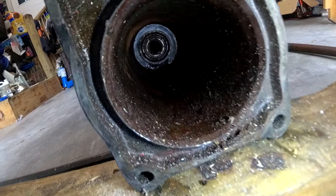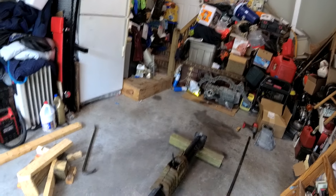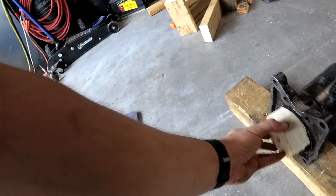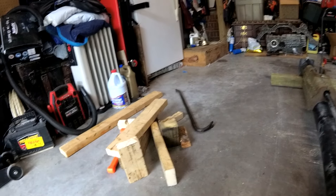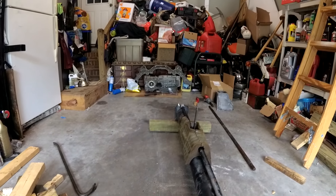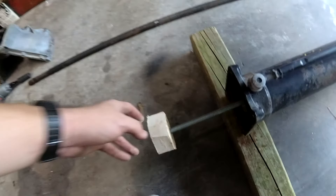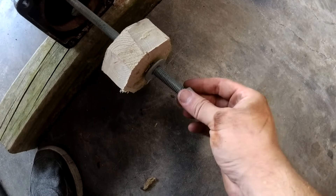There's some dirt and stuff in there — we can try and get it out before we drag the bearings out through it. First things first: I don't have any fancy woodworking tools, so the wooden block I cut out to fit in there looks like crap, I know. We've got some all-thread, so we're going to go ahead and put it through the tube just like the driveshaft normally goes. Wooden block on this end, and get some nuts and washers — on this end just one nut and washers will probably do the trick just fine.